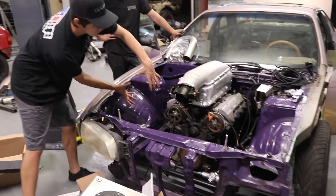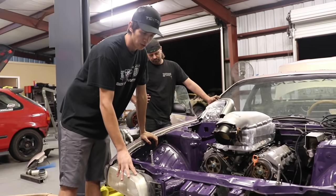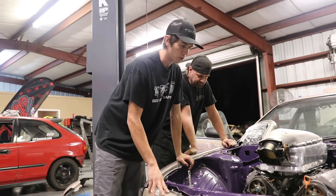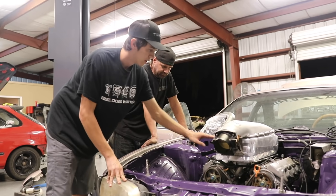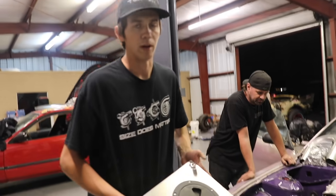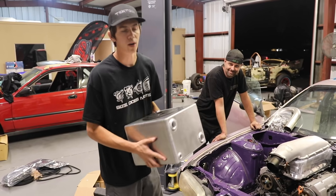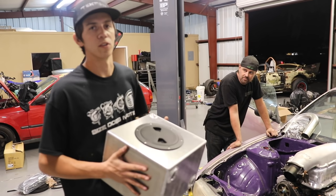We're gonna have both the turbos mounted up right here, and then with this, we won't have to put a traditional intercooler on it, so that frees up a whole bunch of room for us to put the big full-size radiator with the oil cooler up here on the front, and we don't have to worry about all the intercooler piping. We can literally just come right off the turbos, make a Y to go up into here, and all of our cooling will be right in that guy right there. Then we can ice the ice box right before a burnout or whatever we're about to do to make a pass, and we can be pumping ice cold water through the intercooler, and hopefully that'll help keep the intake temps down, because especially in a burnout contest, it's going to get hot, so we're trying to cool everything as much as we can, and I think this is going to be a little more efficient overall.